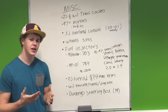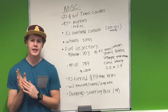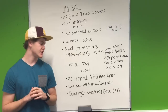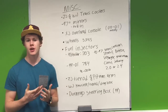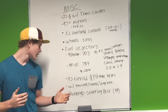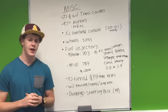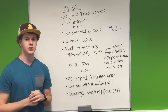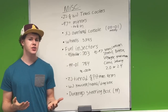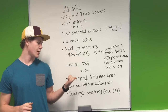The last three are all steering upgrades. First is the ZJ tie rod and pitman arm. The stock Cherokee tie rod is really thin and hollow, but the ZJ one is a solid piece so it's not going to bend as easily. The pitman arm provides a 1-inch pitman arm drop, so if you've lifted your Jeep and want a little drop, just grab a ZJ one. Next is the WJ knuckle, tie rod, and drag link. This is a bit more involved than just swapping the tie rod, but it gives you a really strong steering system and converts you from the stock Cherokee's inverted-Y setup to crossover steering.